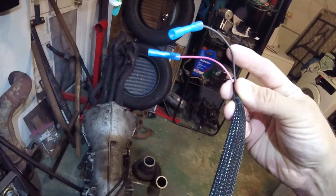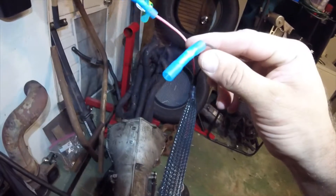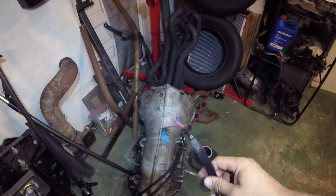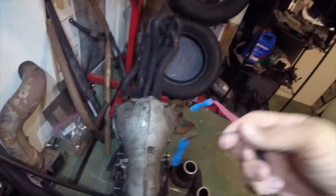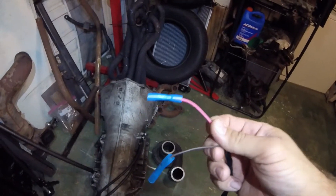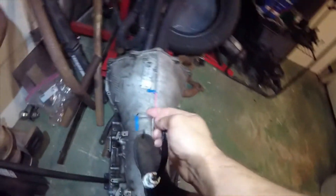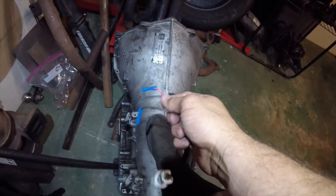Essentially you take this, wire a couple wires together, and put them to power — which would be the pink wire — then connect the black wire to a switched ground, meaning it doesn't complete the circuit unless you flip the switch. This is for the lockup converter, so you'd be cruising on the highway, hit the switch, ground it, and it locks up your converter for better fuel mileage. You just hook it up to a fused, keyed or switched power source.